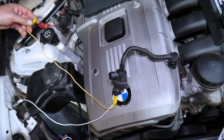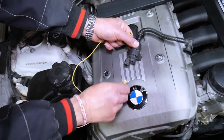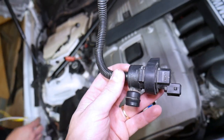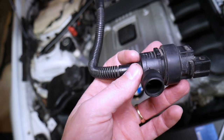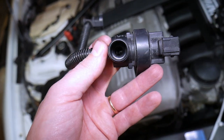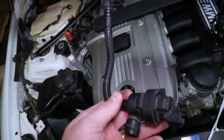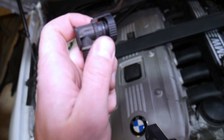You can see how it actually moves the paper. That means the valve is opening and closing correctly. If it makes the noise but doesn't mean it's working — you need to check the airflow. This is important because sometimes it may click, but if the valve is broken on the inside it may not actually open and close. As a result, you might think it's working when it's not.